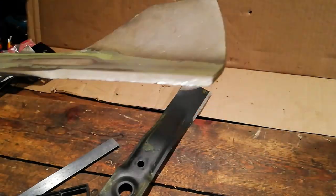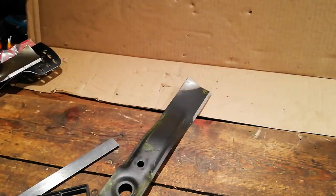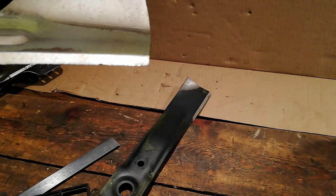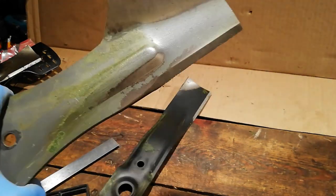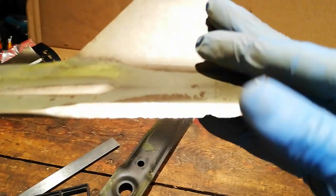So how often should you sharpen a lawnmower blade? Basically when it needs it. When people say they sharpen every two weeks or once a week or once a month, I think that's a load of rubbish, because I could be cutting a lawn and in the first 20 seconds hit a couple of rocks and that blade's game over. So use your ears - if you hear your mower hit anything, you can normally hear it if you hit a stone or a bit of wood chip. Just lift the deck up and check your blade, check you haven't got any smashed up bits.